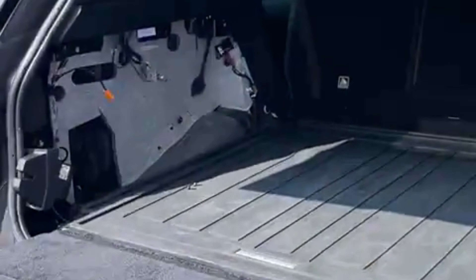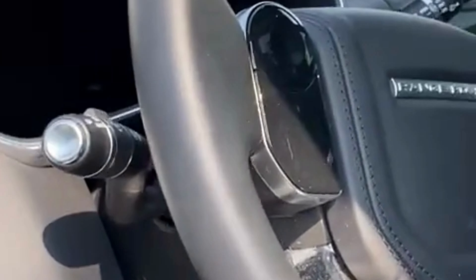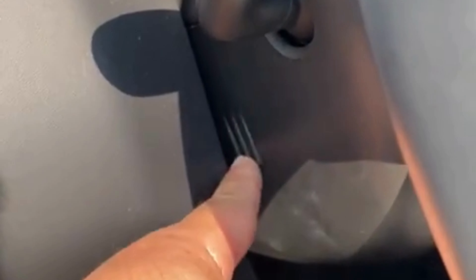The RFA is not connected to the vehicle — it's still in my hand — and you can see that key is on the BCM. Again, there is no RFA connected; you can see the plugs right here. Now I'm going to the vehicle. Sometimes the steering wheel is pushed all the way in, so if it doesn't fit, I just take it out of the shell of the key and put just the board in. You can see there is no recognition. I'm gonna go ahead and put the key right against the reader.